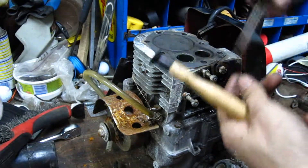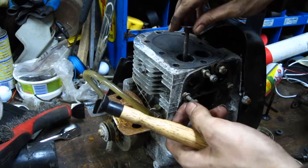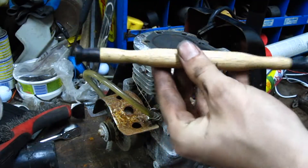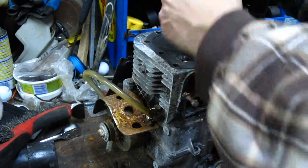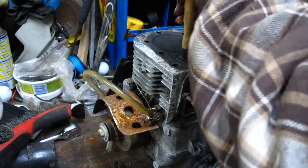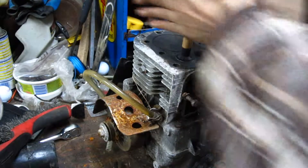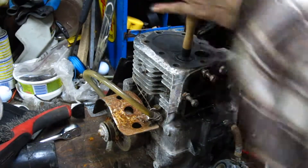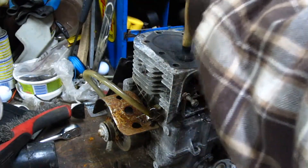First I'm going to lap the intake valve. You're going to put it on — you can put a bit more on if you like, but I'll see how this goes first. This is a valve lapping stick. You can get this at NAPA or any parts store. There's usually two sizes, small and large — the large one is for bigger valves. You're going to want to stick it in the middle, or as close to it. It's just a little suction cup. You're going to want to twist it kind of quick, spin it in small increments, then pick it up and start dabbing it again to spread the compound around.